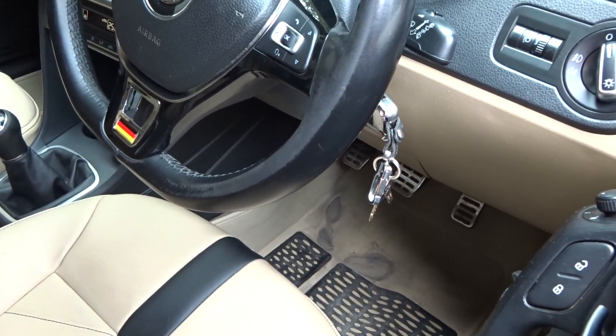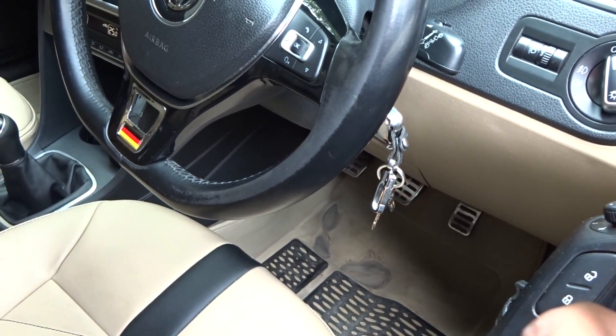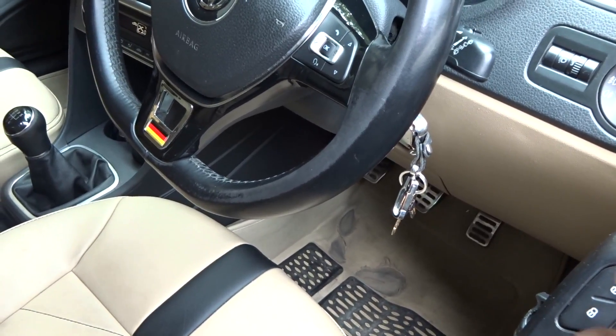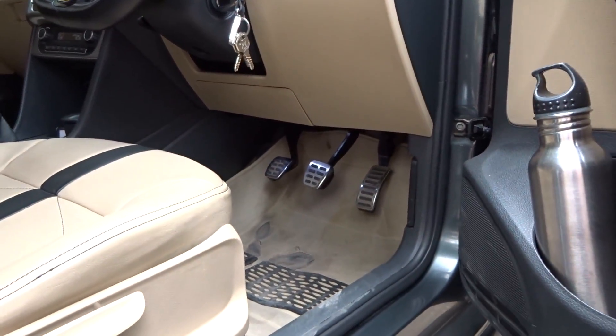You can see that even the lightest input on the steering wheel is getting translated to the wheels. That means our steering gear rack is not worn, but it is moving inside its assembly — and that is the reason for the noise. We can actually eradicate that, and I'll show you how.